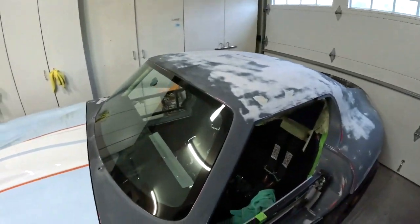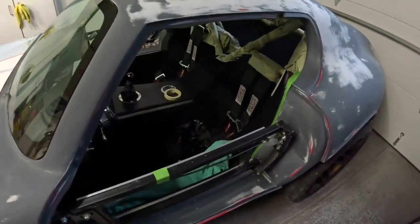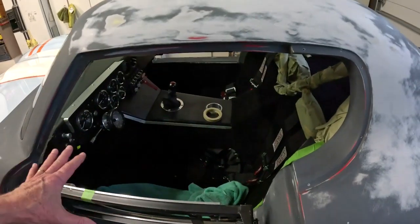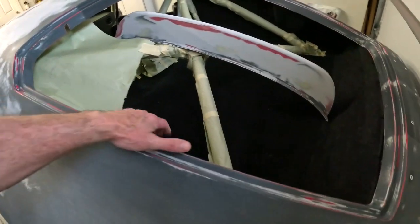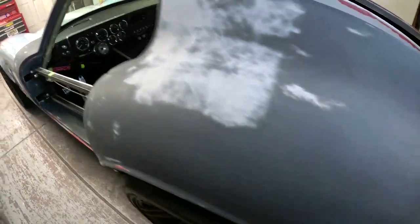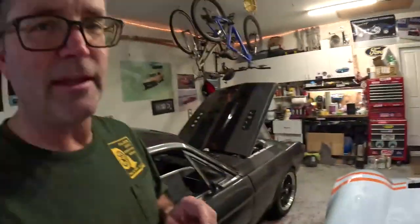Here's the car — doors are off, the interior is pretty much stripped of the seats so I can tape everything off inside. I've got the roll cage taped off because I don't want any overspray getting inside. I'm going to tape off all the carpet as well. The car is pretty well blocked, and I need one more coat of primer. I don't have a booth, so anything exposed is going to get covered in overspray — I don't want that suspension getting coated.